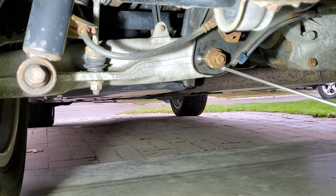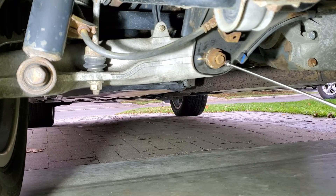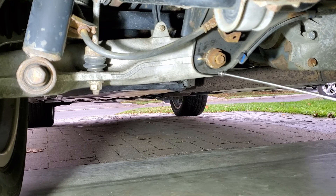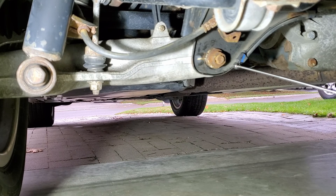In order to do it, you need to loosen this bolt and actually take it off. Use a box wrench on the other side — I think that's 18 millimeter and this bolt here is 21 or 24 millimeter. So you remove this bolt, then use the open box wrench on the other side and turn it either clockwise or counterclockwise to make the flat washer move the suspension one way or the other. You'll see it visually as you're rotating the bolt. Then tighten it, put the bolt back on hand tight, lower the vehicle until the tire is touching the ground, and go measure the camber angle.